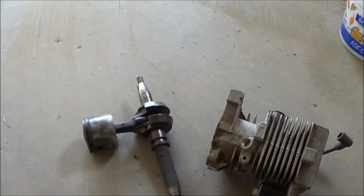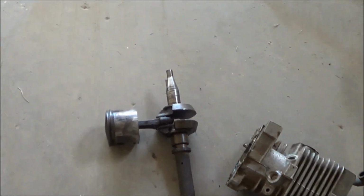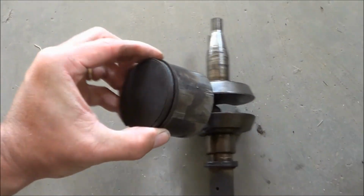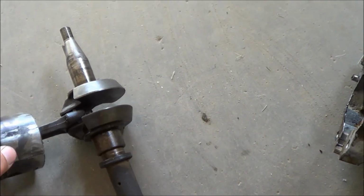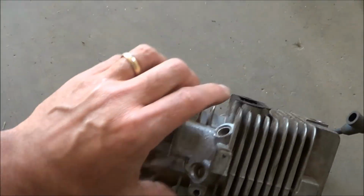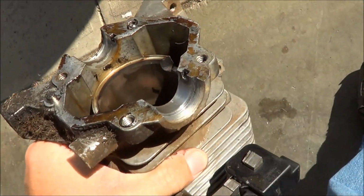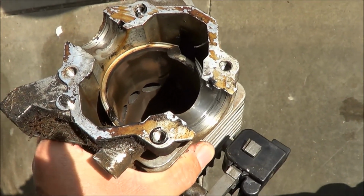Okay, I started out this season with my 475 Long Boy going down because of low oil or no oil in the gas. You can see here, I think what happened is that the ring stuck and tipped, and that causes friction. Can't really see it too well. In the snowmobile world, we call that a four-corner stick because it expands too much.